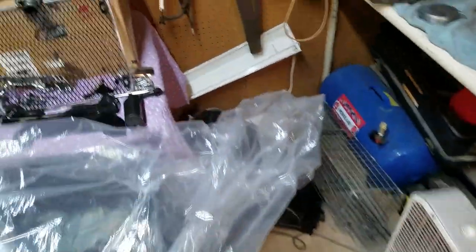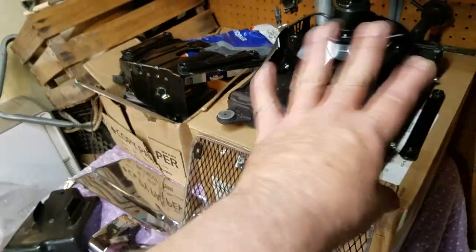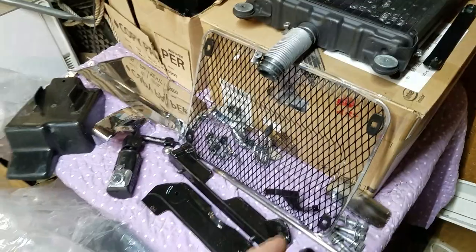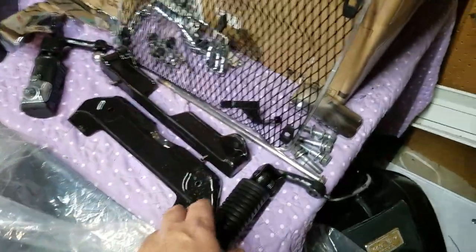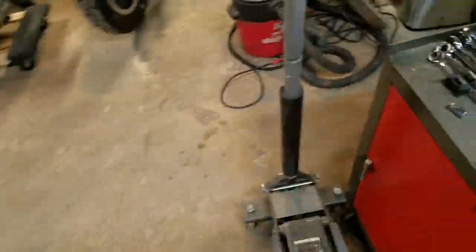I've been doing some other cleaning — I flushed the radiator, got it really clean inside and out, then painted it. This is high-temperature heat paint, which is why it's flat versus shiny. I cleaned up a bunch of other parts, some chrome and some not, and reconditioned the foot pegs — they turned out pretty good. I've got them covered to keep them clean.